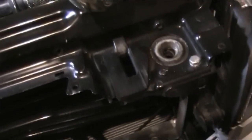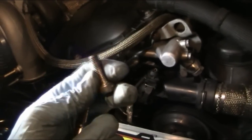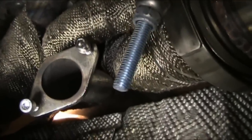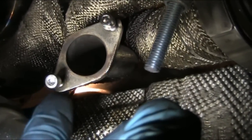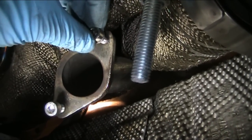The wastegate is out. Now I was warned about this by somebody else - he said that his wastegate bolts came loose. Mine were barely hand tight. I'm guessing that's due to the cheap bolts CX Racing included with their wastegate, which is plausible because cheaper hardware will have a little bit more play in the threads when you thread it in. I'm hoping the better ones have less thread play. I'll put each of these bolts into the holes and see if there's a difference in the play in the threads.